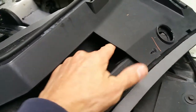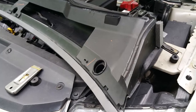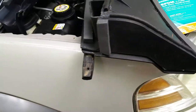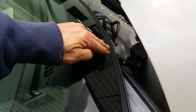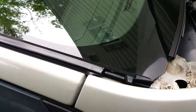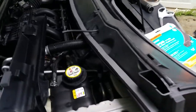Also make sure you clean out inside here too, because there were leaves and debris tucked into that corner that you couldn't really see. Just clean it, rinse it, brush it, dry it off, and then apply the weather stripping. Once I put this back in place with the new improved weather stripping, it should help prevent debris from falling down under it. This is a 12-year-old car that was mostly stored outside rather than in a garage, so that's also an issue.